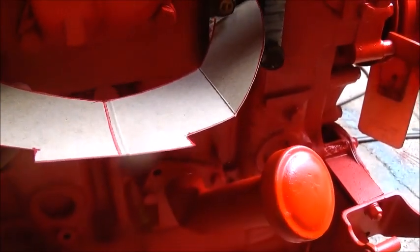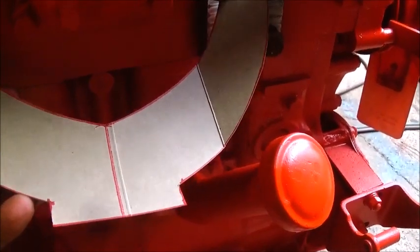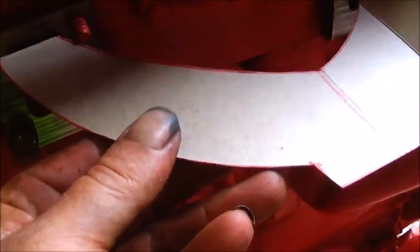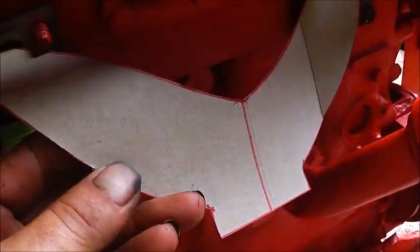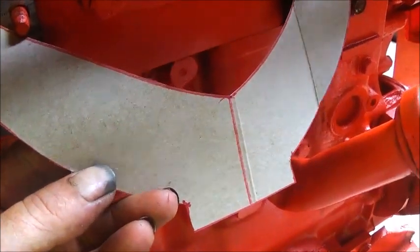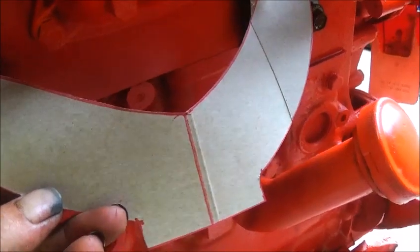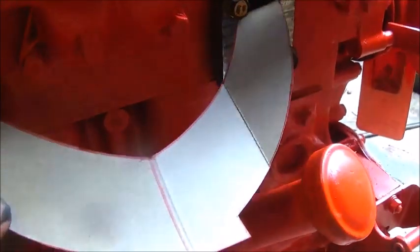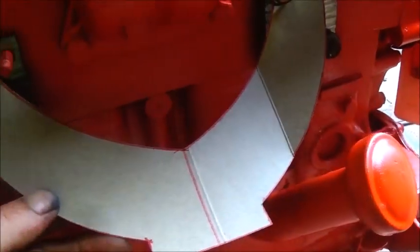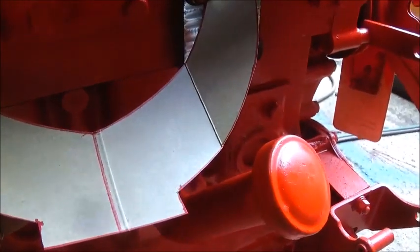Now, they'd be different if I was going to roll it up or down. If I wanted it to come down, I could actually put a roll in this, and it would roll down just like this. And this is the way we used to do intakes, not exhaust, but intakes, when we tractor pulled for the updraft carburetors. And I could actually bring this down some, and that would just about solve my bolt problem, but I really don't want to do that.